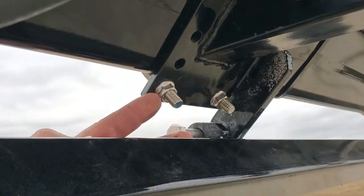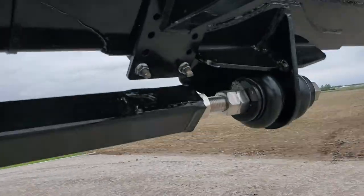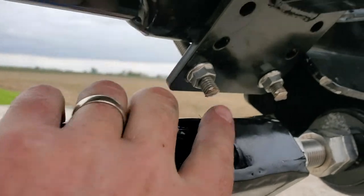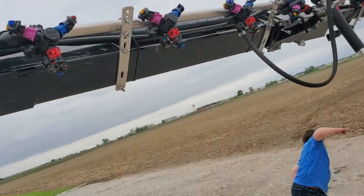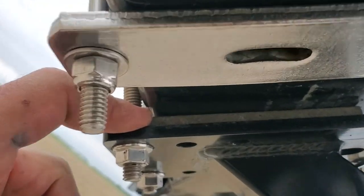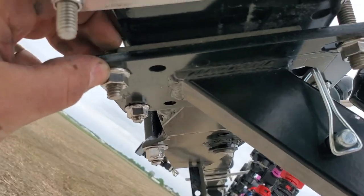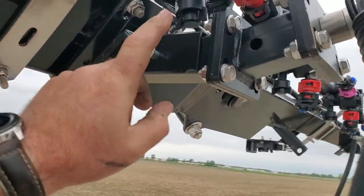The next one we're back to a 6-inch because of all the fish plating — so it's a 6-inch plate. We had to cut the u-bolts just to get them to fit. Six-inch u-bolts, 6-inch plate with an offset. On this one here we've added a quarter-inch shim — hopefully by the time anyone else sees this you'll have a proper quarter-inch poly shim for that.